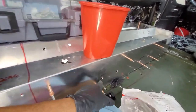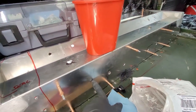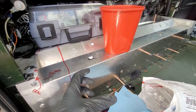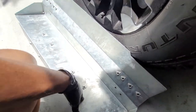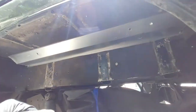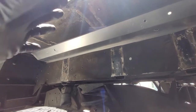Then I'll sandwich those two plates. When I sandwich them in, I'm going to bolt the bracket tree on the bottom, bolt the seat in, get it all real nice and tight. Once it's nice and tight, I'll drill some extra holes and put larger, longer rivets to sandwich all three plates together — through this outside sheet, the actual metal of the car, and this thick galvanized piece. Then I'll be able to unscrew the seat, unscrew the bracket tree, put the carpet in, spray the carpet glue in, and reassemble everything. I'll be done with this side.